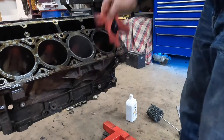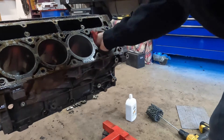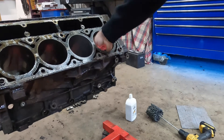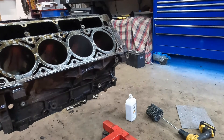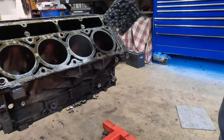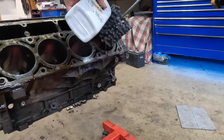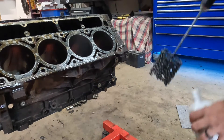First things first, we just kind of wipe the cylinder out — any crud or debris, we don't want to be dragging that around through there. This engine is heavily, heavily crudded up, and that's why it is going to the machine shop to get checked out and cleaned out. But we want to do our honing first because we are putting a new set of rings in it. I've already lubricated the ball hone — let me go ahead and put a little bit more oil on it, just drizzling it on there so it goes into the cylinder.